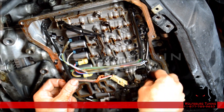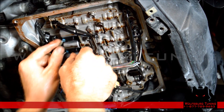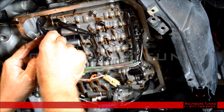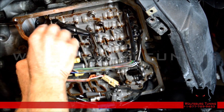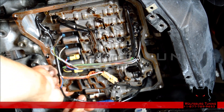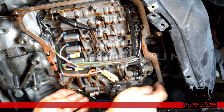That's how our harness should look. Everything's connected — you're going to want to double-check all your plugs to make sure they're tight. You don't want to have to come back in here. Then we're going to tuck them into the clips that hold the wires; there's one here and one around the back. That'll hold them away from the pan.